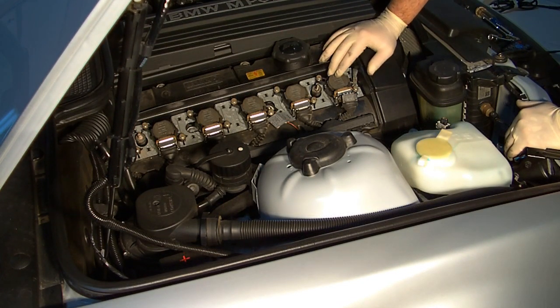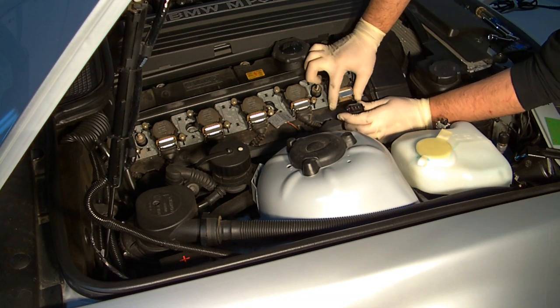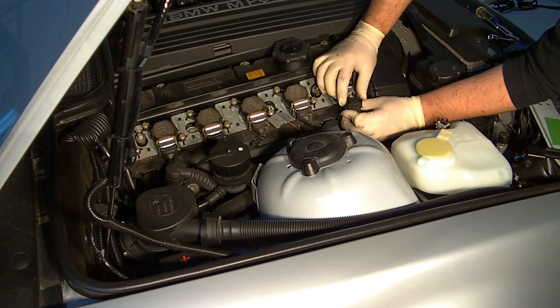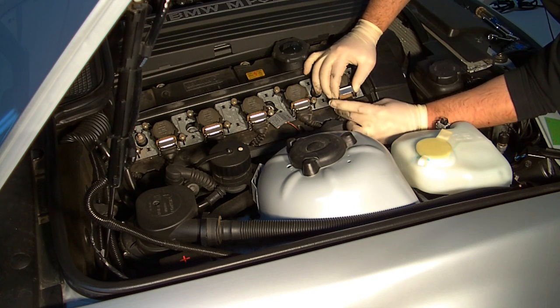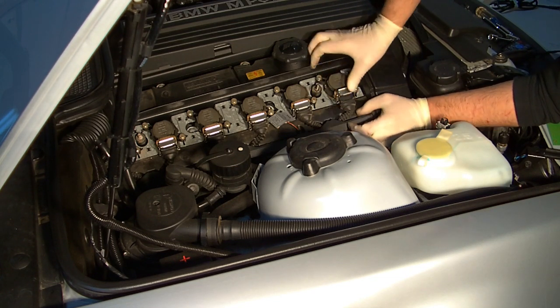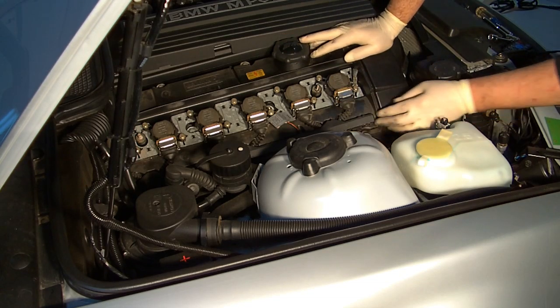The plug has been put in, and it's helpful to use anti-seize compound on the threads of the plug. Then the ignition coil is tightened down with the two bolts. Getting the electrical connection back in — there are a couple of ears that go into the clip, this metal clip. If you take a close look at it, you can see how it works. You push down on the clip and that holds it in place.